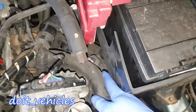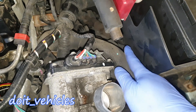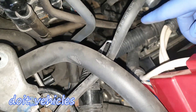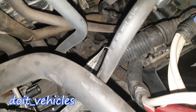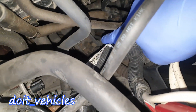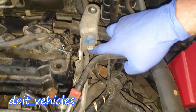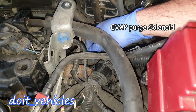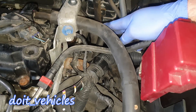If you look under here you can see the manual transmission, and you've got that lever which connects with the gear shift inside the cabin. Down there you can see the clutch pedal shaft. This is the oxygen sensor connector — sensor number 1. Below here you're going to see the solenoid for the evaporative system. To this solenoid you've got 2 vacuum lines connected.